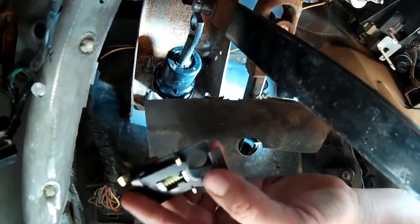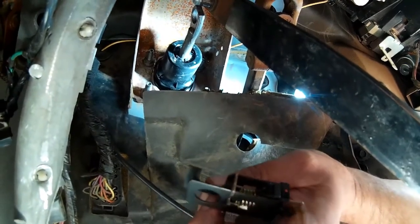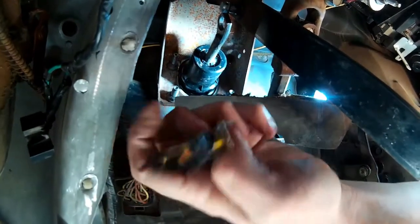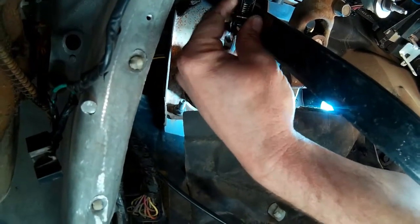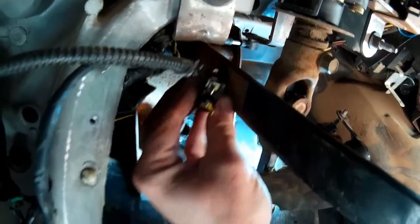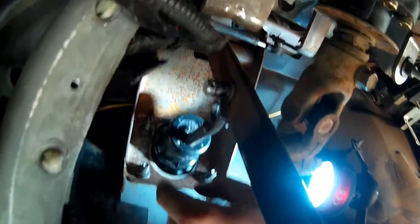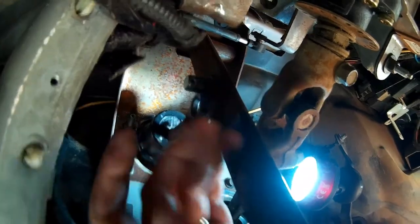When you reinstall it, make sure that the circle part — the enclosed side of the brake light switch — is on the outside, and the U for slipping it over the push rod is facing up. So it'll go back on like so. I've got to take these four nuts loose, push the booster out, fish it out from the engine compartment, and we're good to go.